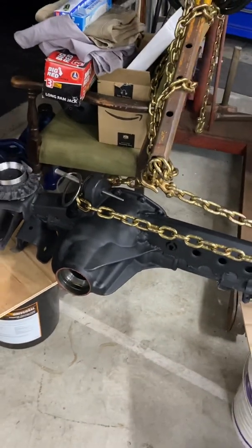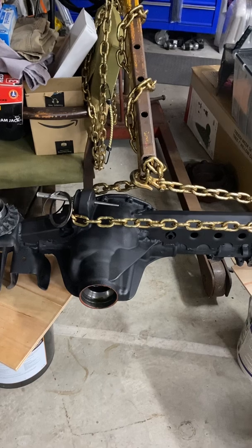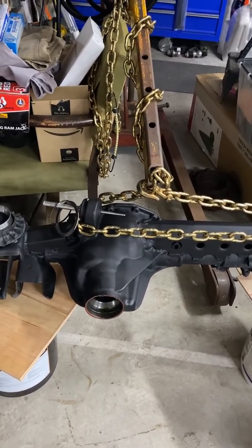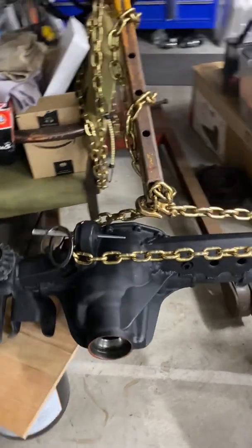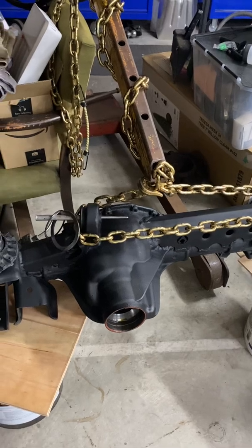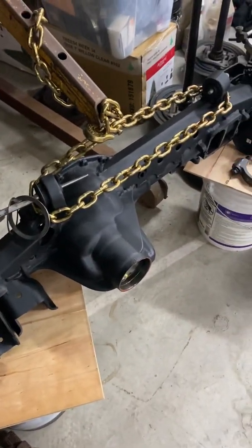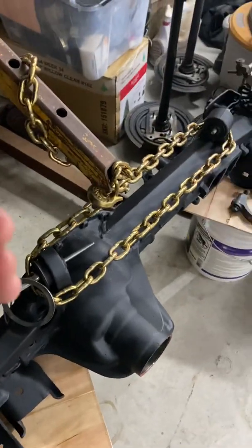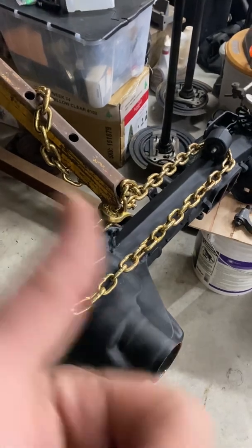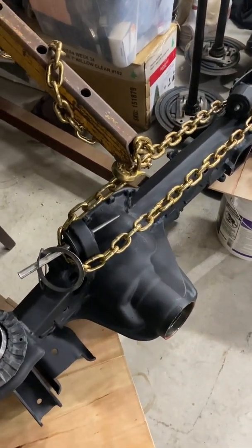It's a JL 44. It turns out that at this point in time they don't have much as far as aftermarket kits for this thing — like you can't go to the auto parts store and order a shim kit. They don't have anything for a 2020 Wrangler. I did find some things from RockAuto that I've ordered and we'll see if they work. This is on hold because I can't get the spacing even close to right — the backlash is massive even with the carrier all the way over. I need to push the pinion in with pinion spacers, and then we should be in the ballpark.